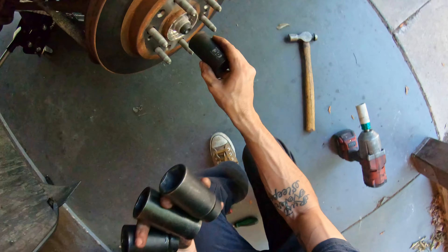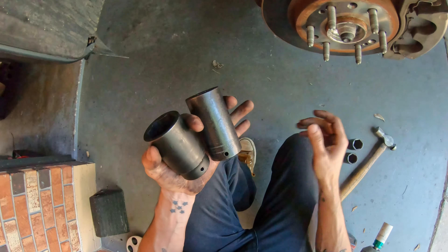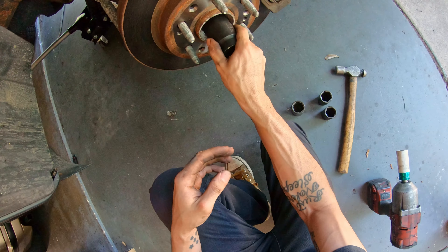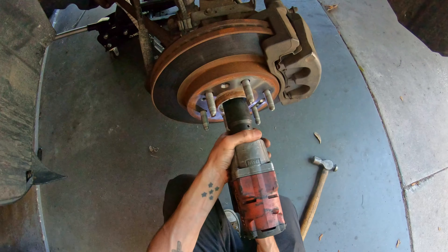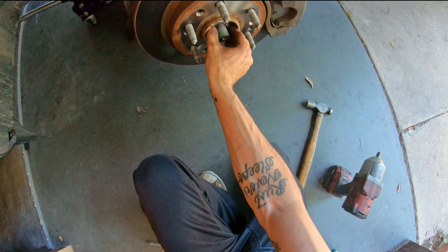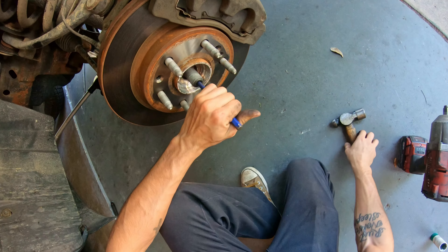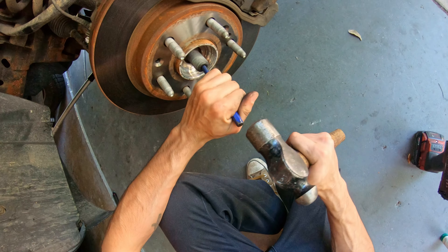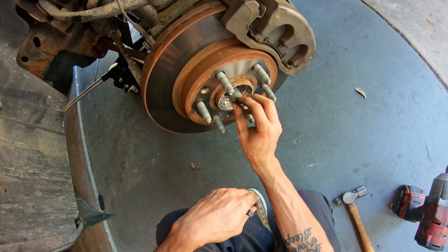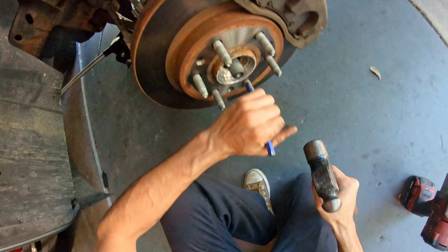One of these sockets has to fit. It's not a 30, not a 32, not even a 33 — 36 is close enough. Make sure you grab your washer in there. Give your axle a tap to make sure it's free in there. If it looks corroded, spray some WD-40 or something. But make sure you don't tap on the actual end of the axle because you'll mess up the threads — put something in the center instead.